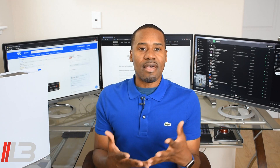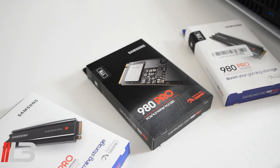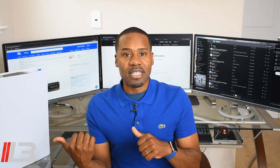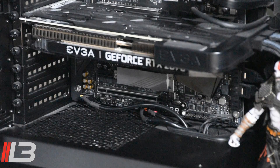If you just take it out of the box and put it in your PlayStation 5, you're only going to see around 5,000 megabytes per second. I have a couple of drives here because I'm going to update the C drive inside my computer as well as update another 980 Pro for my other PlayStation 5. We'll go to my PC, install the one for the PS5, update the firmware — I'll leave links to the software in the description — then we'll install it in the PlayStation 5 and check the read speed.